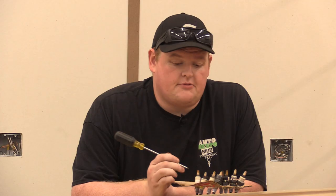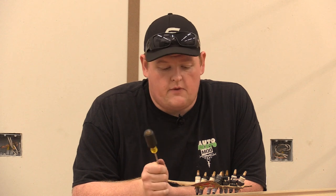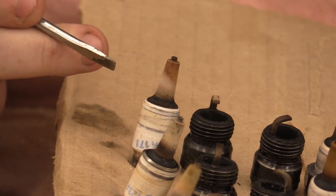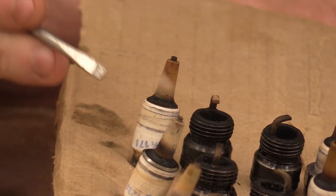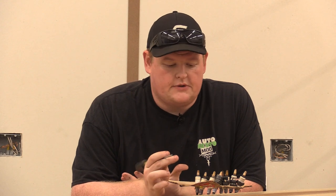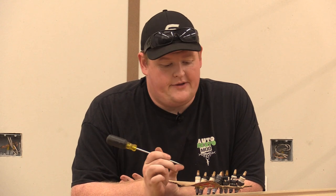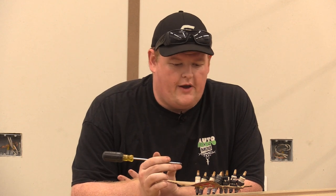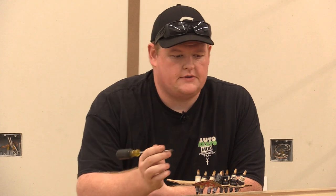If you're at a drag strip doing this and you go for a run for a quarter mile at wide open throttle, all of this is going to be burnt off and the only reading that you'll have is the wide open throttle reading. So when you do wide open pulls, typically it kind of resets the porcelain so you can't get a good reading, but this thing's just been cruised around, so we have a pretty good idea of what it's running like pretty much on all cylinders.